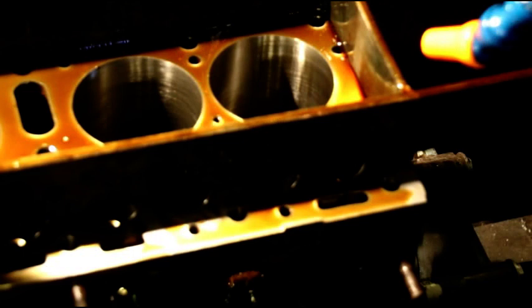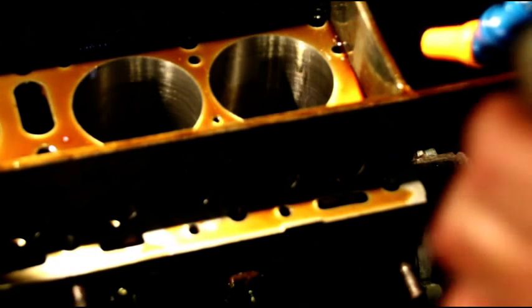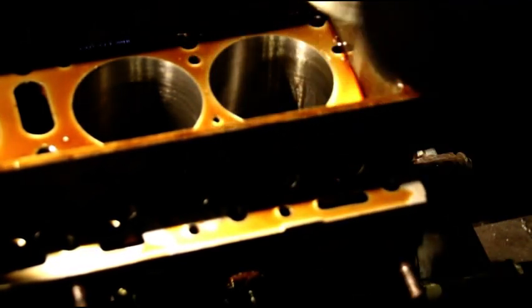Lou, I tested all four pistons on the first hole that's finished and came up with this guy. We hit very close to 3.185 inches. We throw a 3-thousandth feeler gauge in there, give it a pull, and feel the drag on that. That's just something you learn to figure out after you do so many engines. We hook that piston up and send it down the length of the cylinder. You can tell by the feel that we've got a perfect hole. That's going to be number four piston, and we'll fit all the others the same way.